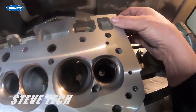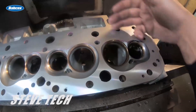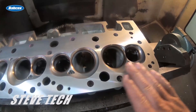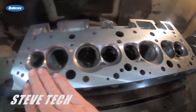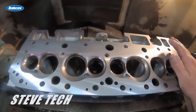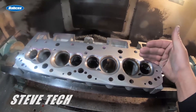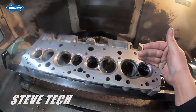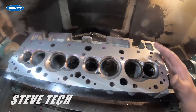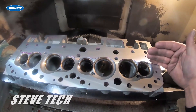You can see this is an extremely nice surface finish — very uniform right through here in the valve seat area. It doesn't tend to drag or make a different-looking surface finish. If the cylinder heads you get back don't have a perfectly shiny, perfectly flat, beautiful-looking surface, they're not really right. Typically, around ten thousandths is going to be in the range of one to two CCs per combustion chamber, though that varies depending on what kind of cylinder head it is.